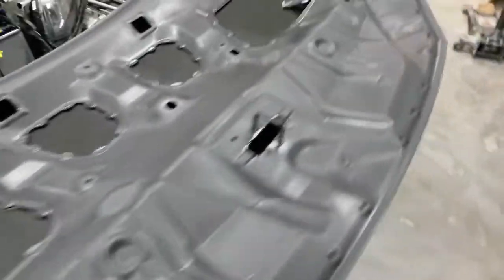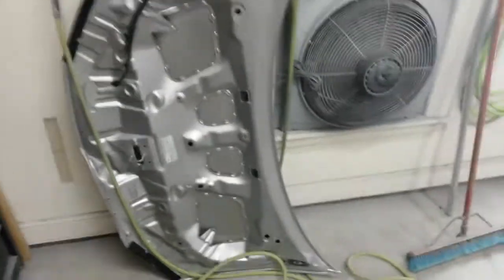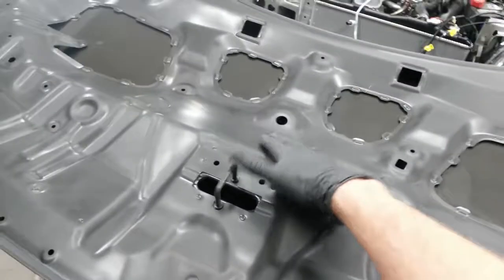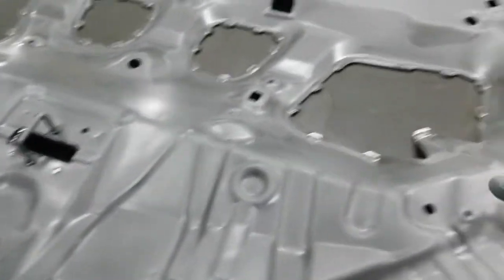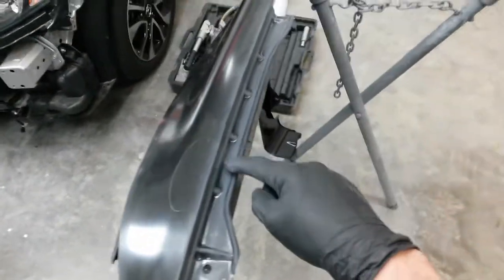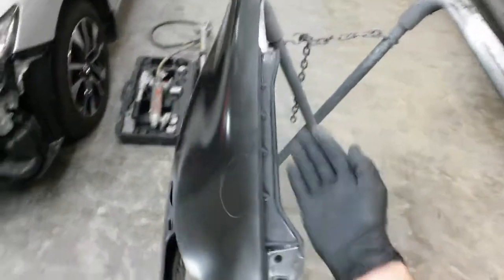I've got underside of the hood scuffed. All this gets covered with the hood insulator that's over there. Well, was over there. It covers this area. Took it off already. And label will go here and here. I've also got the hinges. Those are scuffed. And the fender, I'm just going to do the inside edge. I may do that when I put it on the car since the hood will be off. I may just back mask it here and do this whole thing at one time.